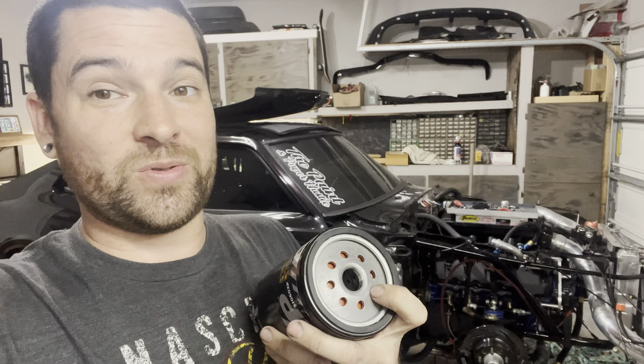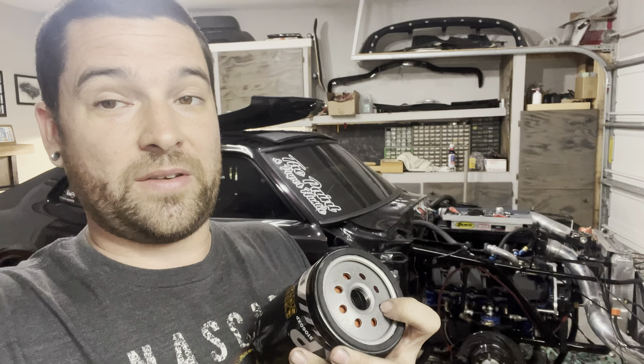When you're hooking up a motor of any kind and you have a remote oil filter housing, a normal motor has the filter housing on the side of the block — your normal screw-on filter, just like this spin-on regular oil filter. From everything I gathered, dirty oil comes in around the outside and returns to the motor from the inside. What we do know without being extremely technical is that oil goes into this filter and flows out of this filter. What happened with mine was I had the lines hooked up wrong — basically the wrong flow direction, because it does only flow in one direction.